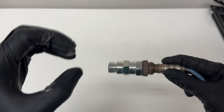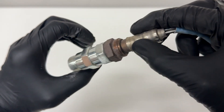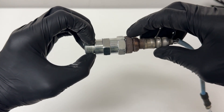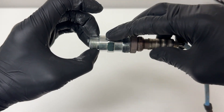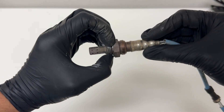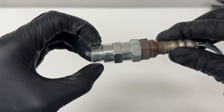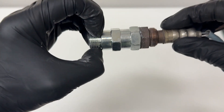The way this works: picture this is your exhaust pipe or catalytic converter with gases flowing through the inside. This assembly screws into your exhaust pipe or catalytic converter, which allows the O2 sensor to sit outside of the exhaust pipe, clearing all of the gases. Prior to installing this non-fouler, the O2 sensor was sitting inside your exhaust pipe in direct flow of the gases. If your catalytic converter was not doing its job, it was not detecting clean air and was throwing off your check engine light. So this non-fouler acts as a spacer to allow the O2 sensor to sit outside of the direct flow of gases so it can detect clean air.